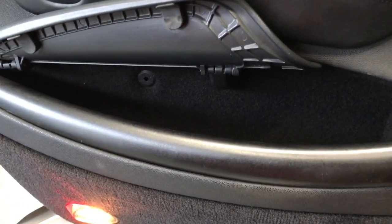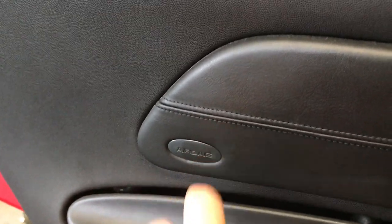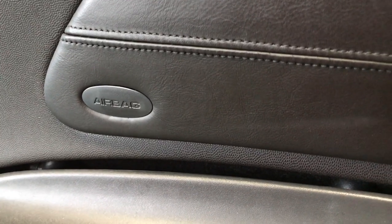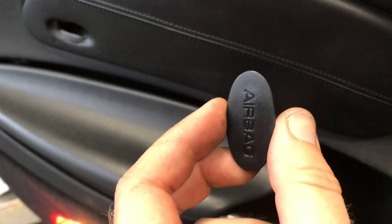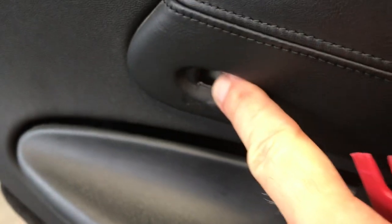The driver's side door is definitely different — not just with that screw, but apparently there is another one further back behind the airbag area. I've heard that's very easy to break, so I'm going to try to reach in from behind to push it out and get something back there to get that last screw out. It wasn't really that bad — I used the pry tool on the bottom so any marks wouldn't be noticeable, and just very slowly pulled it through all the leather. As you can see, there's one more bolt holding this thing in.